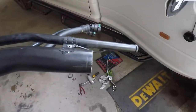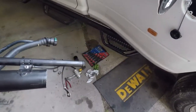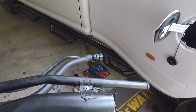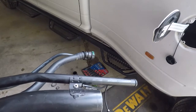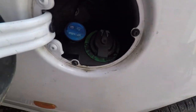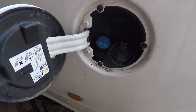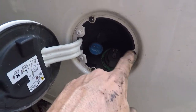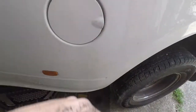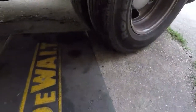No big deal. So we're going to get under there, install the adapter, snug it down a little bit on the fuel tank side, and then try to slip this thing back in. Alright, so she's back in. That went in pretty good. Remember, these just go into plastic, so tighten them till they strip, back out half a turn. That'll do it. And underneath, doesn't look too terrible, but give me a minute, I suppose.